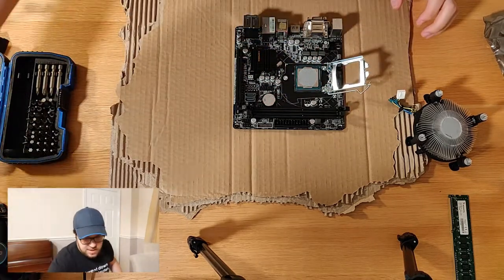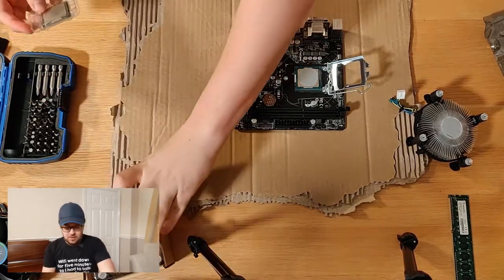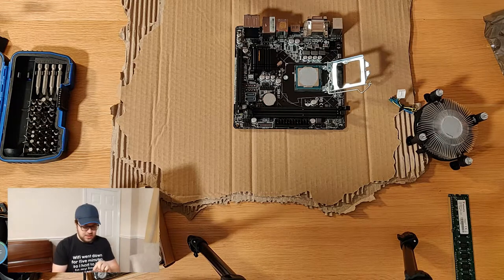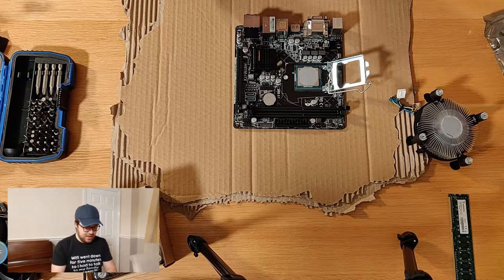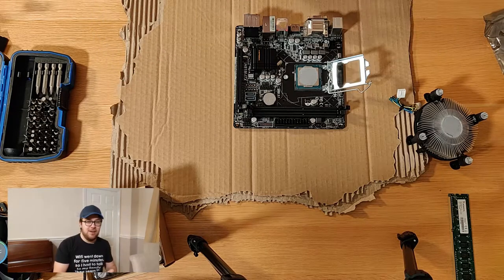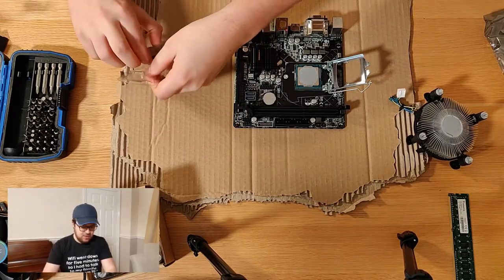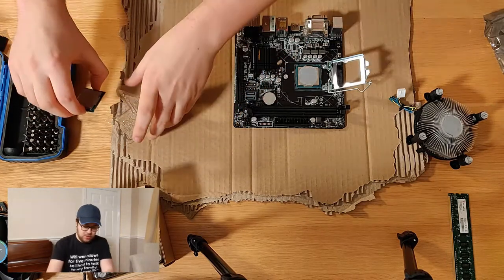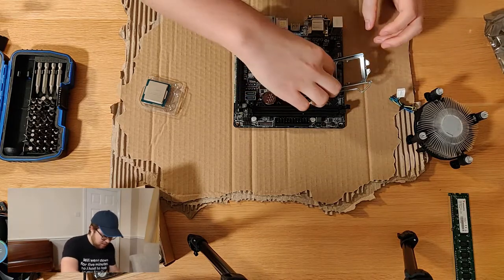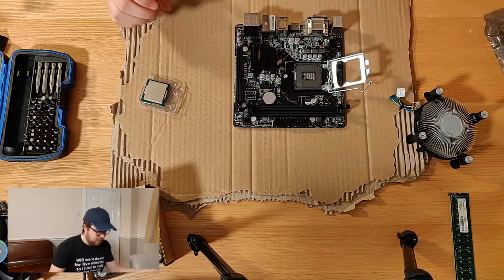Now, I have got my replacement chip here, so let me open this up first. Might be able to see that. So just an Intel i5-4670K like we went over on the last video. Not the fastest chip compared to the modern chips, but at the time, pretty damn fast. So this chip will have no thermal compound on it, which is, you know, when we get to the cooler, you'll actually see what I do with that. Let's just whip this chip out and put it down in some relatively safe space. I'll just put it over on this static bag over in the corner.